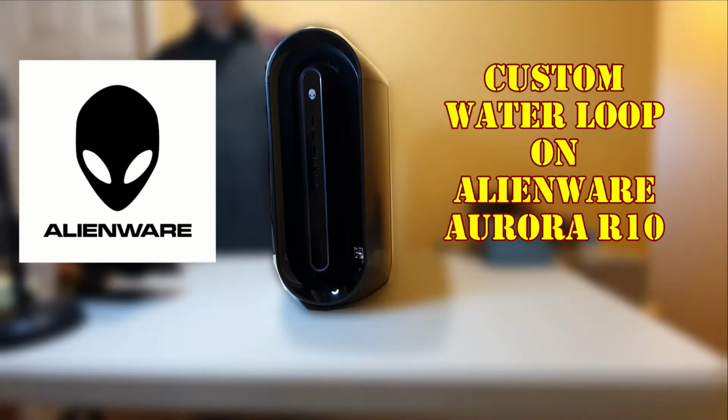Hello guys, in this video I want to take you through the process of trying to make this Alienware Aurora R10 cooling system a bit better. This particular model came with an AIO on the CPU, so although the cooling performance of that AIO is not that bad, it's really noisy because the original fan that it comes with is, I think, 3900 RPMs at max speed. And aside from that, the airflow inside the case is really bad.